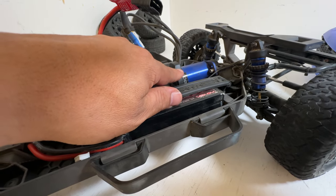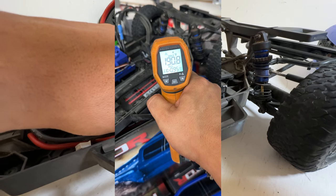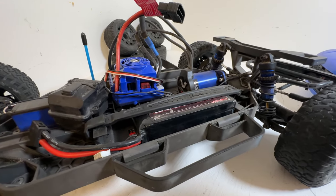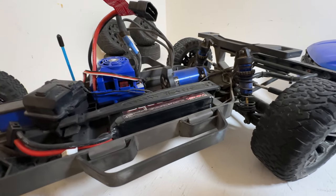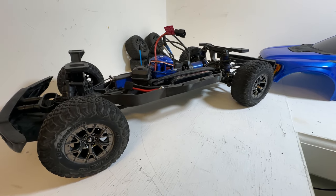Even with that upgrade, the motor will run at 194 degrees, which is a little too high. You want a motor no more than 180 degrees, otherwise you're going to run into problems ruining your windings and magnets over time. So you're definitely going to want to get a 28,000 RPM McLaren motor fan and install that on the motor. That's going to help you out.